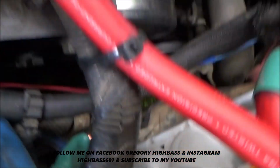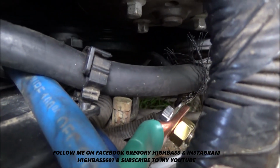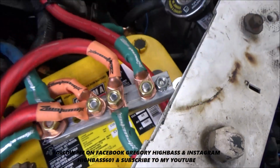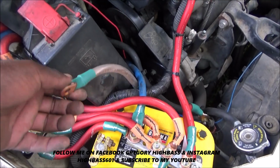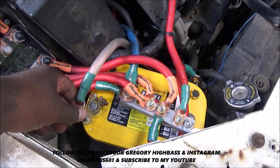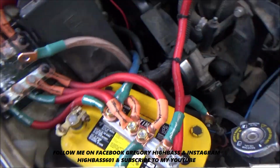Same thing with the ground. I put a nut on it. Well, there it is right there. A nut on the ground to make it longer. Okay, so I get all this hooked up. Finna connect this negative to the ground. Everything hooked up, I'm thinking everything cool. Check this out. That positive right there is touching that damn frame.